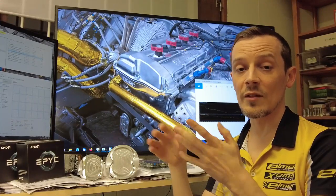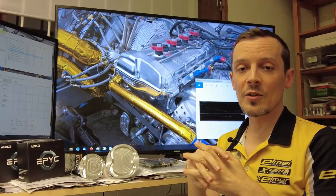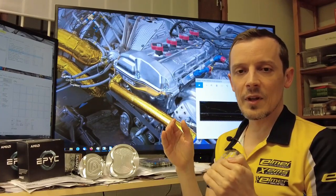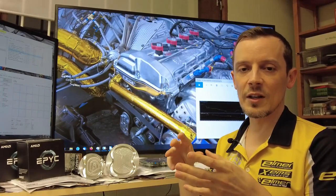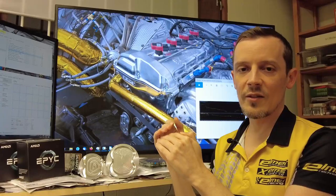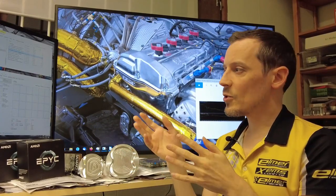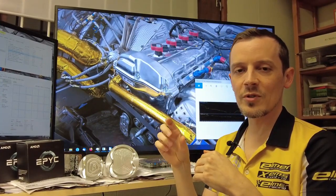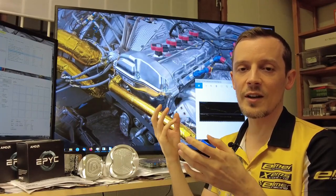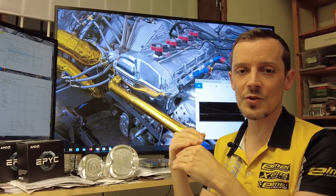Let's talk about pumping losses — basically the combined exhaust stroke and intake stroke and how much power loss there typically will be. If you have a higher integral of cylinder pressure over the exhaust stroke than on the intake stroke, you're losing power — that's a pumping loss. On turbocharged cars it's very possible to have higher boost pressure than exhaust pressure, especially in racing engines. With restrictor engines it's slightly more difficult because you lose so much efficiency on the compressor section that you need to run more energy through the turbine section, which means comparatively higher back pressure.